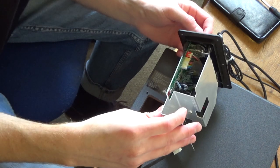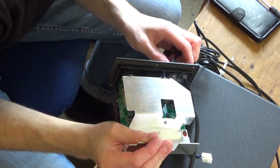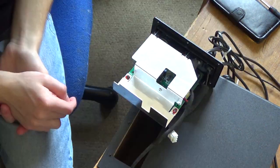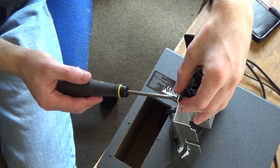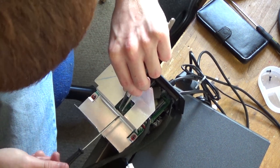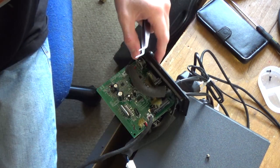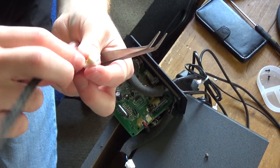The bass adjustment is just a potentiometer. There's that — that's probably holding the face plate on. So to remove this aluminium heat shield and heat sink it looks like those four screws, and then I should have access to the main board. It looks like these are held on with some form of resin, but I'm hoping I'll just be able to break the seal by unscrewing the screws. Yes I can. I may need my pliers for this — actually these tweezers are working fine. There we go, now I have access to the main board. You can see the glue that Logitech uses just didn't even work.